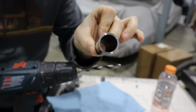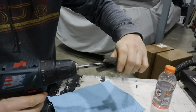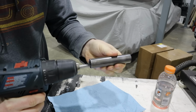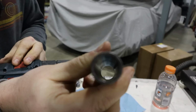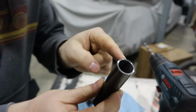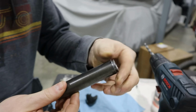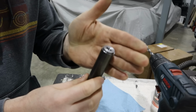I want to clean the inside of that tube. So this side here, you can see it's got a nice machine finish. I did put this in the lathe and I did my end pass there. So our little bung insert slides in just how it should, and I left that lip so it would have kind of a positive engagement, and we're gonna weld around this seam there.